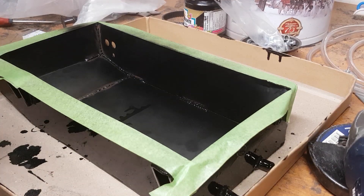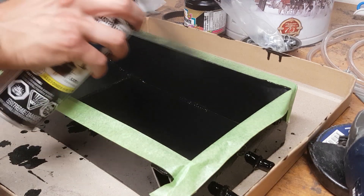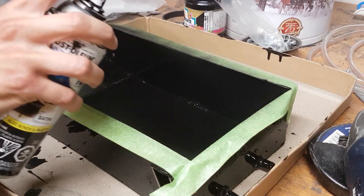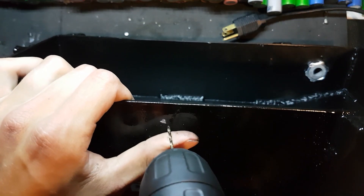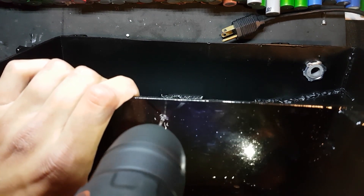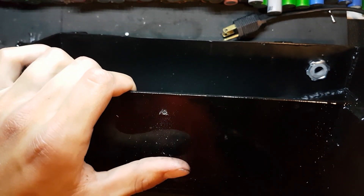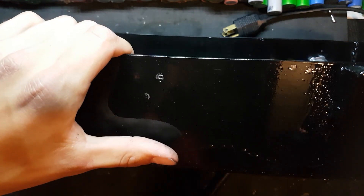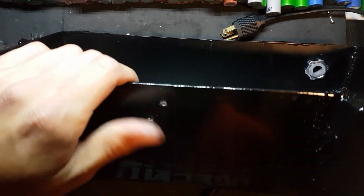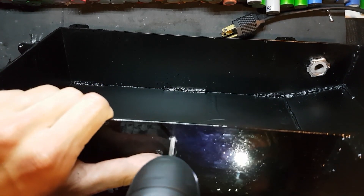As for the inside, I could have left it unpainted, however I chose to put on a layer of spray bomb just to make sure that if any moisture somehow got in there, it wouldn't rust. One step I forgot in fabrication was to drill and tap some holes for the hose clamps, which would hold the water hose as it exited from the front of the box and headed to the rear for the radiator. I drilled and tapped them out to M3, and the hose clamps are simple electrical cable hose clamps with stainless M3 bolts.